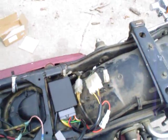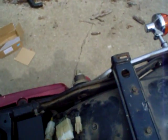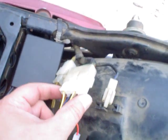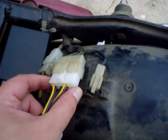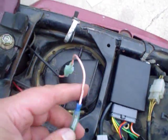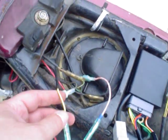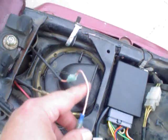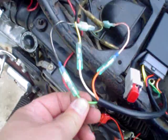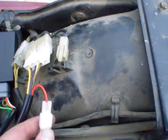The new CDI is installed on the big connector. Clip to clip — they don't actually clip into each other, but that is how it goes on my bike. The orange wire goes to the pink wire on the bike, the white wire goes to the yellow wire which is the left coil. The pink wire is the right coil, right relative to when you're riding the bike. The green wire goes to the black and white wire, which is the ignition cutoff switch.